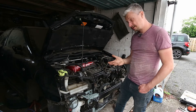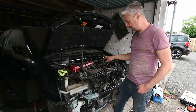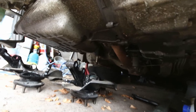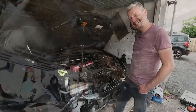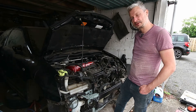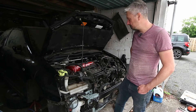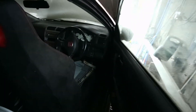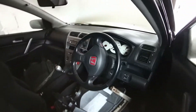The other thing I've got to do is there's a leak at the bottom of the engine. I'm pretty sure it's the main seal at the end of the crankshaft that needs sorting out — it's dripping out from between the engine and the gearbox bell housing. So that could be a clutch job as well while I'm on. We'll see when we get there.